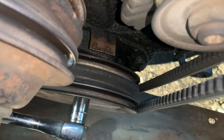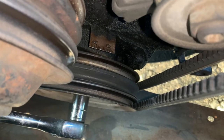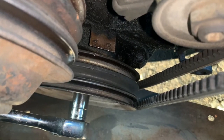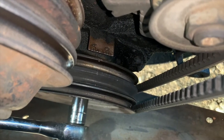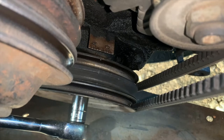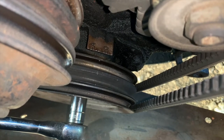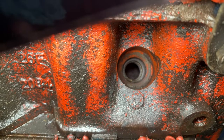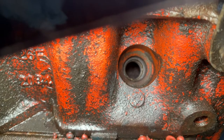Now you can see the groove, and right now we're in advanced timing, so we're going to keep turning it clockwise until we get two dashes before the zero — which is four degrees — and right there, four degrees. Now we've got the engine in perfect timing. The cylinder is all the way at the top on cylinder one, on its compression stroke.